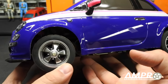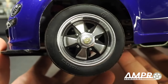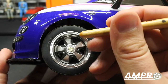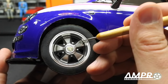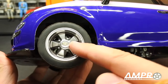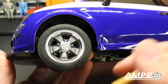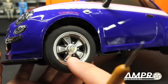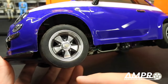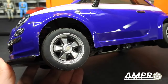The Fuchs posed a very different conundrum. This was the kind of wheel that needed to be painted in steps. You're going to have to paint within the wheel to get that black interior, and there's a little ridge right here that's black, plus the lug nuts — it basically looks like a nightmare to paint. Fortunately I don't want to deal with that. You have to do a lot of masking, and these wheels are intended to have some chrome trim. I used Duplicolor chrome engine paint, an aerosol can you'd find at the auto parts store. In order to get those chrome features you'd have to mask everything off after priming, and I simply didn't want to deal with that.